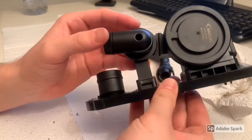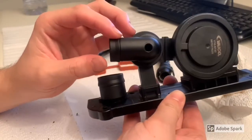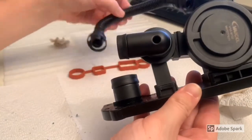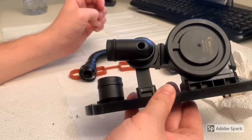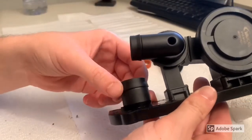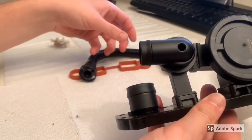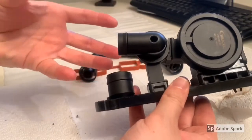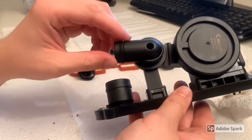In conclusion, you have three choices. First, replace the OEM PCV valve completely. Second, buy a PCV delete kit — removing the original valve and replacing it with a plate that blocks certain ports. Third, and most recommended by most people, install an oil catch can system. This works like a PCV delete kit but with two hoses leading to a catch can that must be cleaned regularly. It maintains proper engine crankcase ventilation like the OEM PCV valve, but also filters excess air and oil.